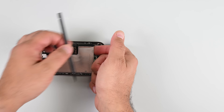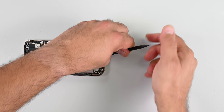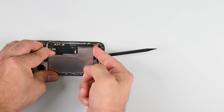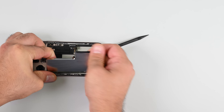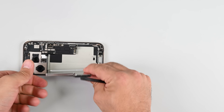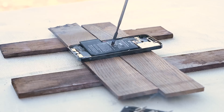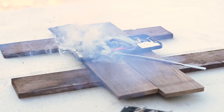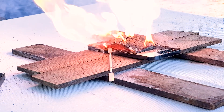Let me show you why an encased battery can be so useful. I couldn't get the first stretch-release tab all the way out, so I'm applying a bit of force to leverage it out. You should never do this with a standard lithium polymer battery like the one in the 16 Pro Max, because it can bend, potentially creating a short between layers inside the cell — and if that happens, a battery with enough energy can ignite. Obviously don't tempt fate even with an encased battery, but this demonstrates how robust and safe this lithium-ion battery is.